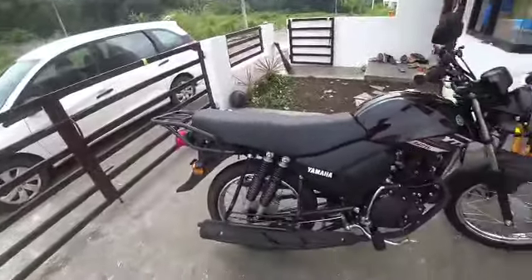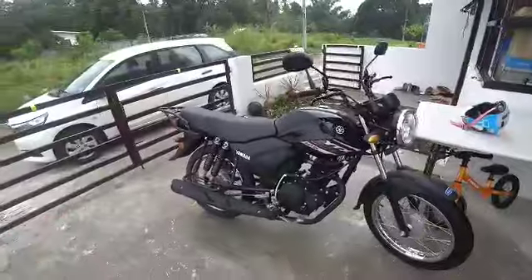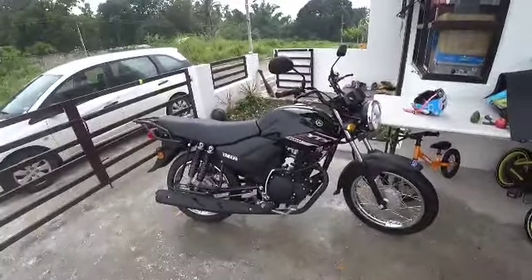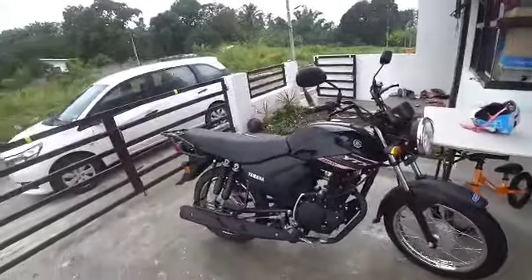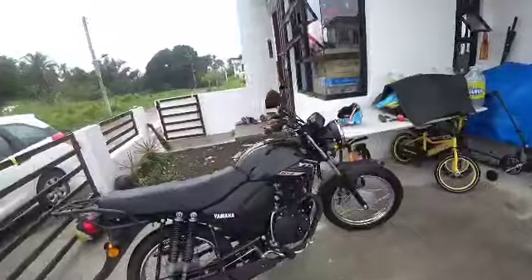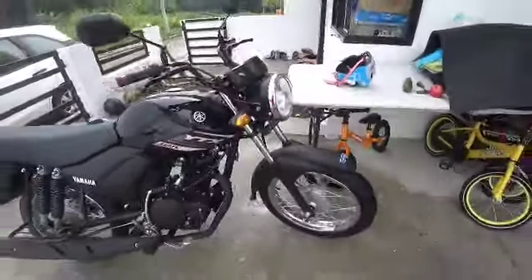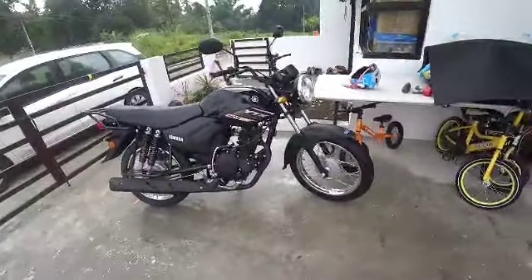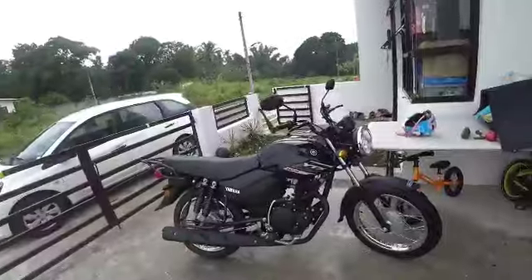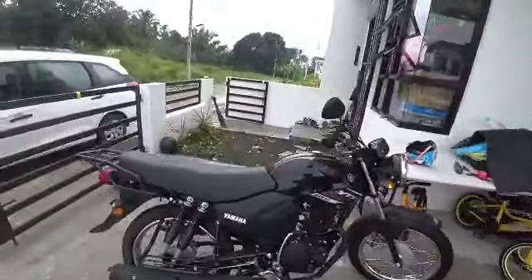I'm loving the old-school feel. I already took the kids for a little ride. I'm going to adjust the rear brake — I like it a little tighter. At 500 kilometers I'll take her in for the oil change; I got a free first service. I'm going to put synthetic in — it takes 20-40 and runs on regular gas. I put 450 pesos worth of fuel in it and it's got a nice-sized tank. These fenders are staying on — I went through puddles and didn't get my feet wet at all. It's also going to be re-registered as a tricycle next year; it's got all the mounts under there ready for it.